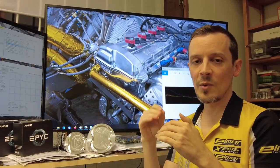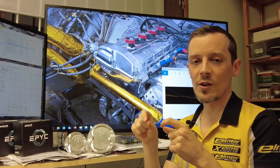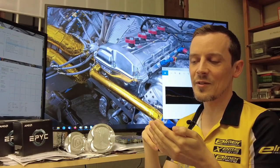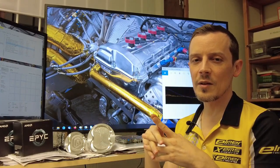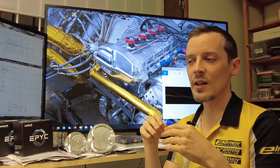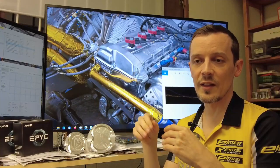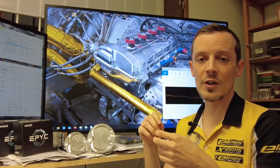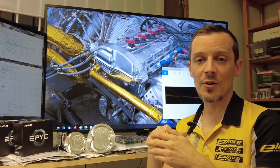There could be around 5 to 10 horsepower of friction loss savings by heavily optimizing the valve train — running as soft valve springs as possible and roller rocker setups. But roller rockers have higher inertia, which limits your maximum RPM. I think the bucket lifters we're using currently are a good compromise. We do have very stiff valve springs, especially for initial engine tuning, because if you encounter misfires during setup, you don't want the engine to immediately blow up on the first misfire or ignition cut.